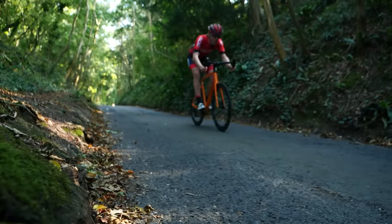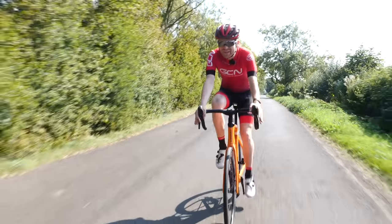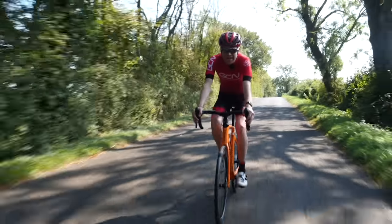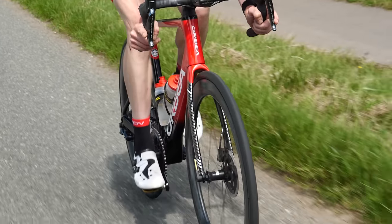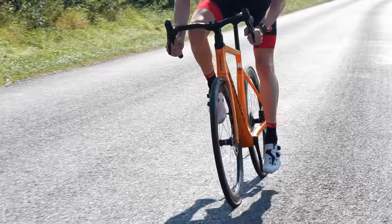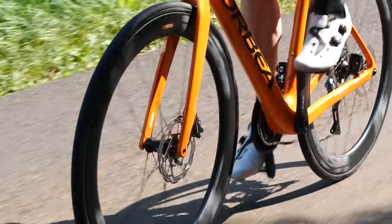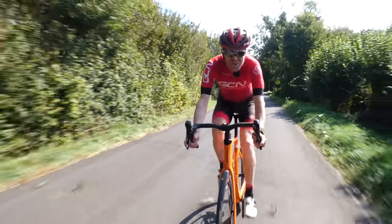Braking is another area where modern 105 is better than old school Dura-Ace. My bike, equipped with hydraulic disc brakes, they offer so much more modulation, power and consistency over rim brakes. They're vastly superior. And the calipers on these brakes are actually the same as what's found on the Dura-Ace ones, pretty much. They're just sort of painted a bit differently. But the rotors are different, however. They're lower spec. And according to Shimano, they're not quite as effective at dissipating heat as quickly as the higher spec Dura-Ace rotors. But irrespective of that, they still absolutely destroy rim brakes.